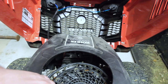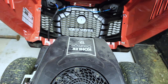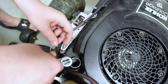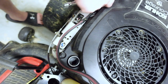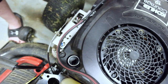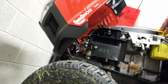And it's basically just the same process in reverse. Guide it to the part where it needs to be, watch out for your fuel line, make sure you're going around that, and it just sets right back down in there. Again, 5/16ths to put this back in — they're long threads so you've got to work at it a little bit. The top's back on. We'll reinstall our little dipstick. We'll be doing an oil change here — it's getting warm out here where I live in Ohio, so we're going to have to do that soon.